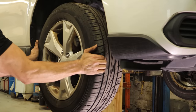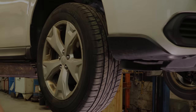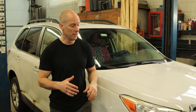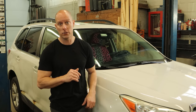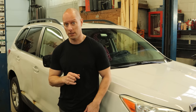We'll throw our tire back on here, and that took care of the play on this side. All of our wheels are securely fastened now, so our noise is gone and our job here is done. We're going to send it for the alignment, and after they get that done we'll recalibrate the steering wheel angle sensor, which should take care of their ABS light. Everything should be good to go. So this is the first time I've ever seen this car — maybe next time I can do all the body work on it. Thanks for watching, and I'll see you soon.